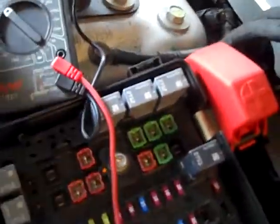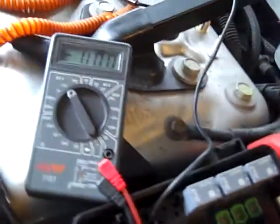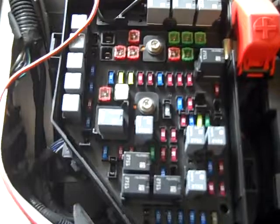I had another good question posted on one of the videos where I was talking about checking fuses, and someone asked how exactly do you do that and how do you know which fuse is for what circuit. So this is the under hood fuse panel for my SRX, and on the back side of the cover — this is the way GM does it these days — there is a road map that tells you exactly what each fuse does. There are also relays and it tells you what the relays do.